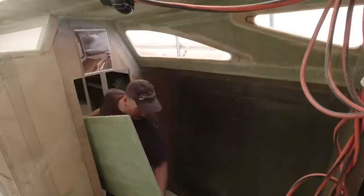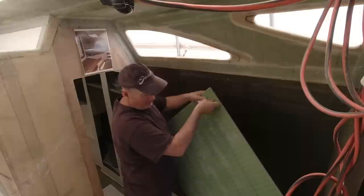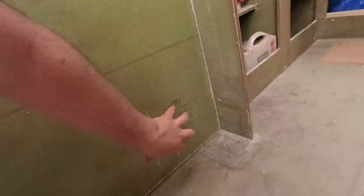There's a lot of stuff in here that can now go back in place. This is where you find that nothing fits after you glue things — you then have to go back and trim because everything was loose. We're currently in a blackout so I can't do any cutting or grinding with tools, only by hand. Down in the back of the freezer I have to allow room for a compressor at the bottom, so I'm going to trim that edge and tab it down to the floor before I put this panel in place. The compressor will be here, so I'll need to put an access hatch in the bottom so I can get to it without lifting the whole freezer unit out — like a little door to check condensation buildup. I may do a door with a vent as the same unit.